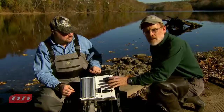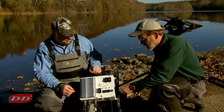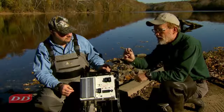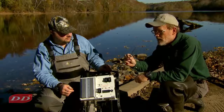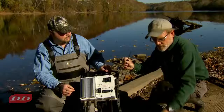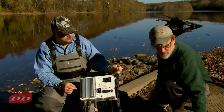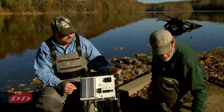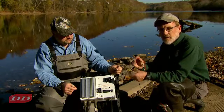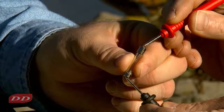Before getting into the box itself, check any external fuses. There's a three-amp fuse on this unit. You can take the fuse out and visually inspect whether the filament is intact. But sometimes these fuses have very small filaments or the lighting is poor and you can't see clearly. A surefire way to check is with your multimeter set to ohms. If the fuse is intact and the filament is good, placing a probe on each end should give a beep and low resistance, telling you the fuse is okay.